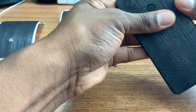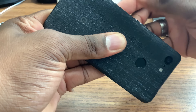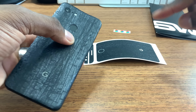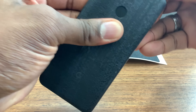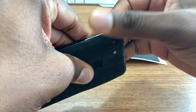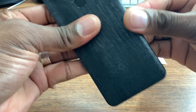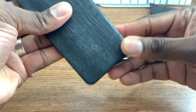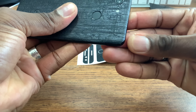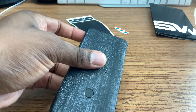When you're applying that heat, you've got to give it a rest — you don't want to heat the phone up too much. With such a curvy phone, skins like this don't always want to work, so you've got to be careful. That's why I got the full sweep here — if I don't like this one or it won't lay down, I can just switch it out. I normally put it in a case and let it sit for 24 hours after I get it heated up nice and tight. Curved devices look good but if they don't have a lot of grip it's a mess. This one is probably gonna need to cure for longer than 48 hours.